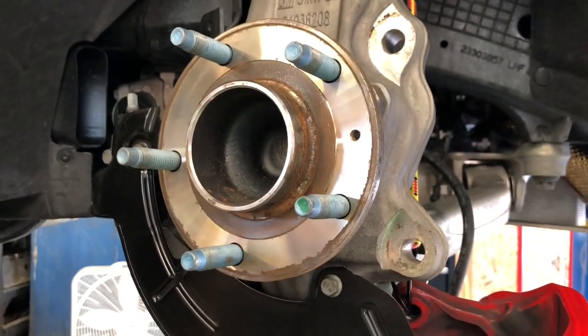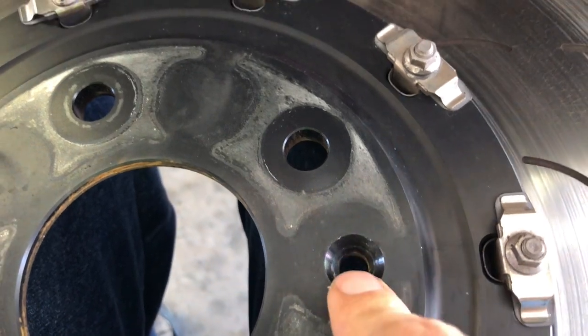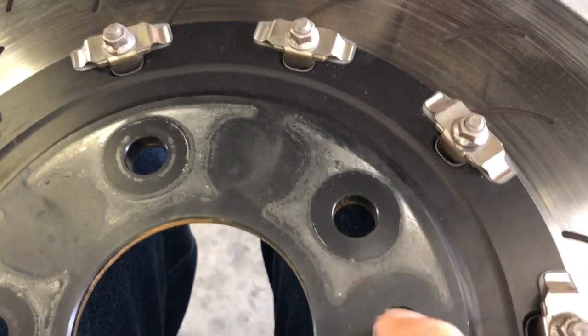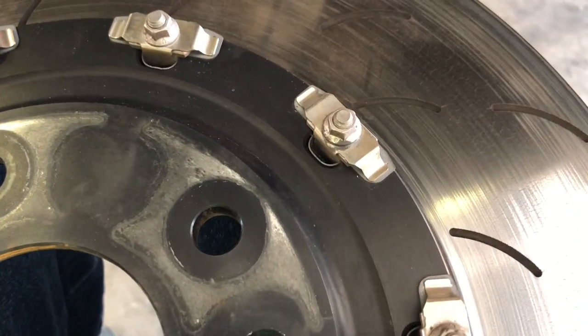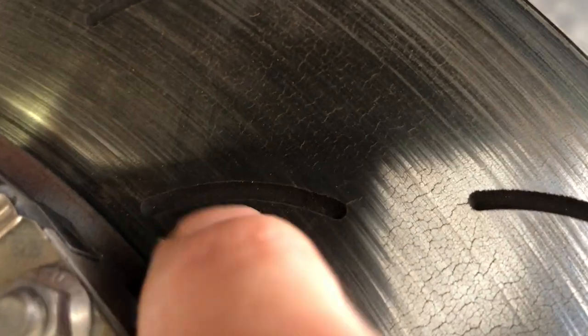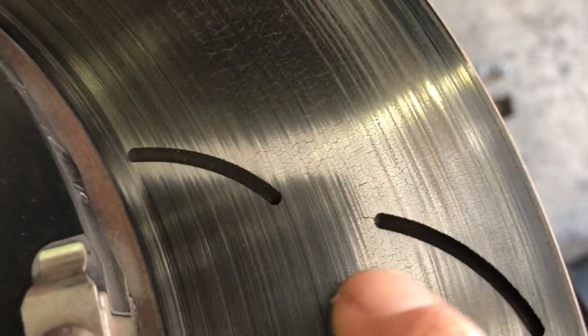Let's talk about reinstalling the rotor. If you've got your rotor up, it's a great time to inspect it. Line up this hole. If you look at the rotor, there are big holes where the lugs go through, and then there is a small hole that has a tapered edge to it — that's where the little rotor-holding bolt with the Torx head goes. If you're at the track, you will find lots of little surface cracks. That is completely normal. The ones you want to watch for are those starting to come out of any cut channels on your rotors, or if you've upgraded to slotted or drilled rotors, check those areas because that's where stress fractures begin. This surface cracking is perfectly normal and acceptable.